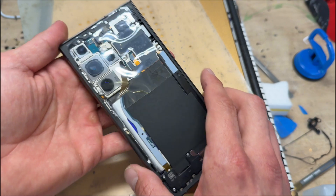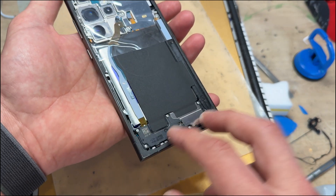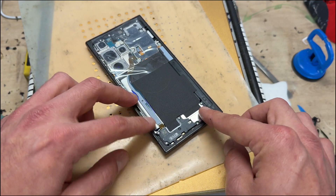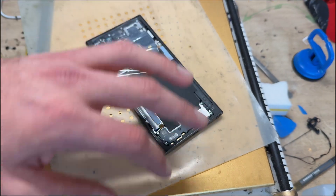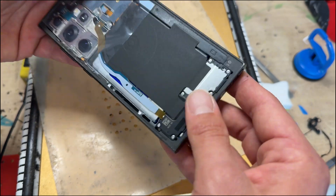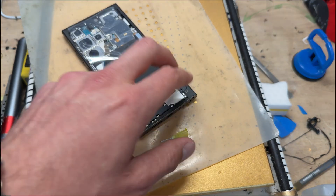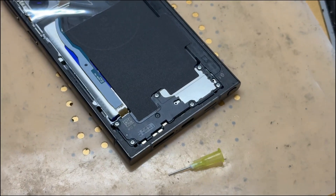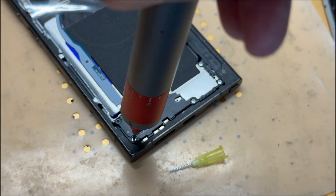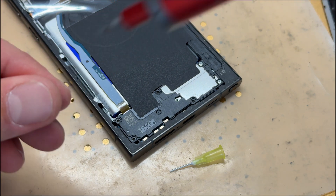This phone is powered off — it's run out of battery because it's not charging. You have an option here: you can disconnect the battery and then remove the charging port that way. However, you can also just remove the speaker assembly and swap out the charging port without disconnecting the battery — it's not going to do any damage. To start, pop out the SIM tray and set it aside, then you've got six cross-head screws holding down the loudspeaker and plastic cover.